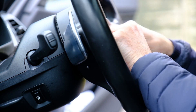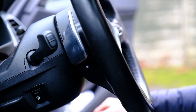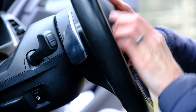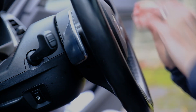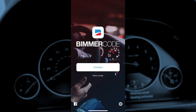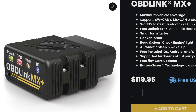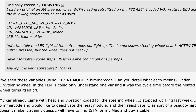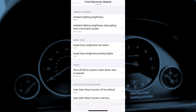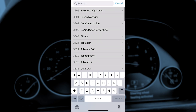Now to put the wheel back on — I found somewhere online that said the centre bolt is 17mm, but it's not, it's 16mm. Another thing to do is tell the car's computer systems it has some new hardware. For this I use the iPhone app Bimmer Code along with a Bluetooth OBD adapter from OBD Link. You need to use expert mode in Bimmer Code to change the four settings — under the front electronic module, select expert mode in the bottom left corner, then search for the four settings.